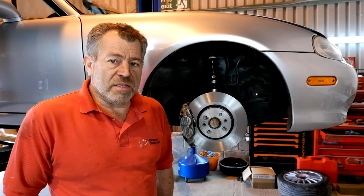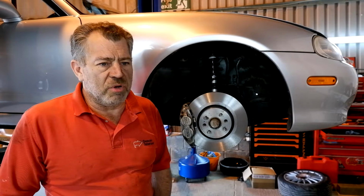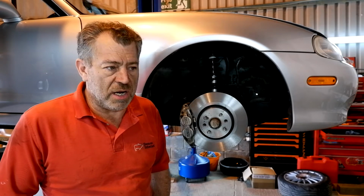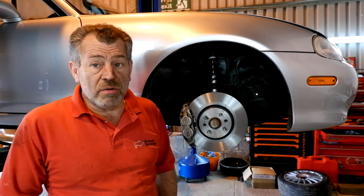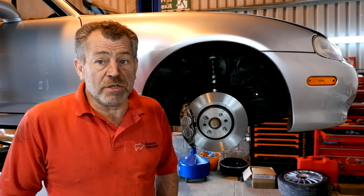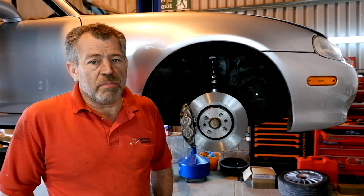Right, well, that's it. I mean, brake hoses are actually really, really simple to change, and I'm not going to show you bleeding the brakes because I'm sure there's many a YouTube channel on how to do that. But you can use your method of choice, whether you gravity bleed them, whether you get a friend to sit in the car, or whether you use something like a vacuum bleeder or a pressure bleeder. There's plenty of options.